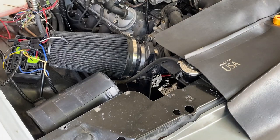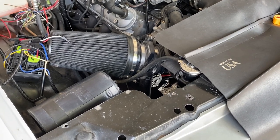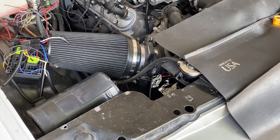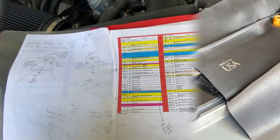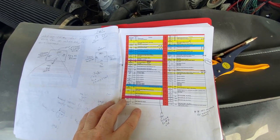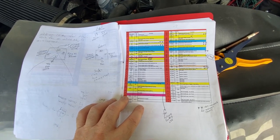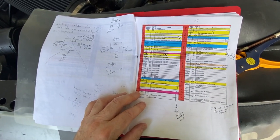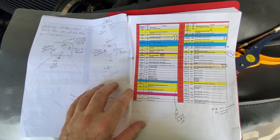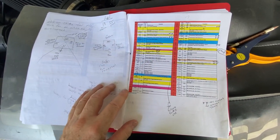I'm going to start it up so that you can see that the compressor does come on. This is looking at the pin-out from lt1swap.com. His original wiring diagram really didn't show using air conditioning. There are some supplemental notes that talk about the air conditioning depending on what you're using to cycle it. Even he admits that he's not an AC pro and he's found some things that work and obviously some things that don't.